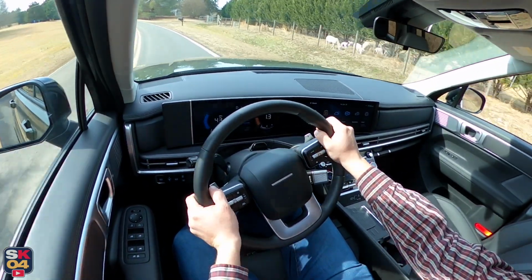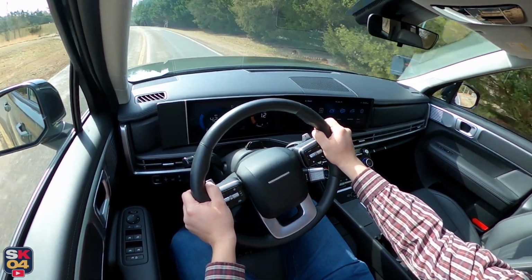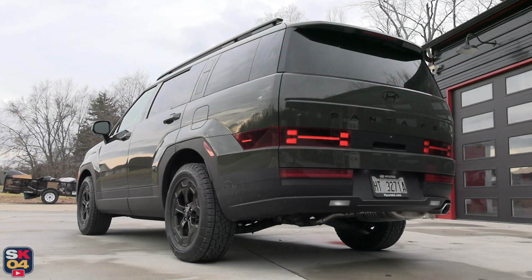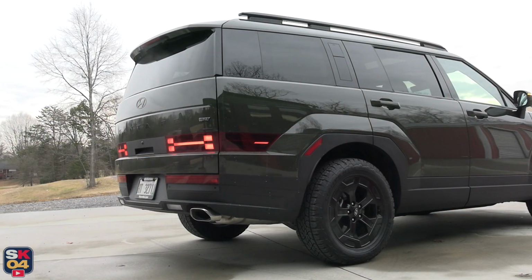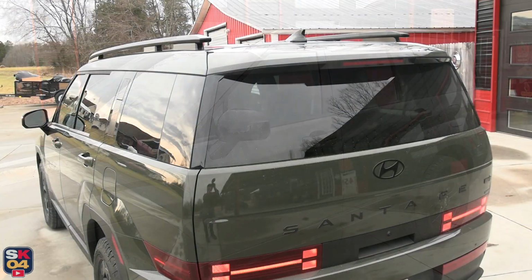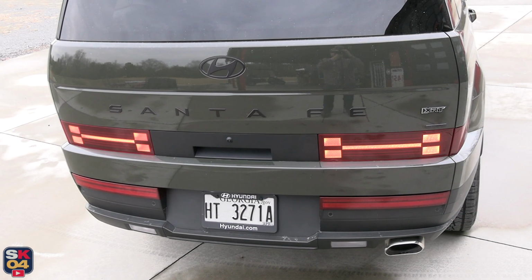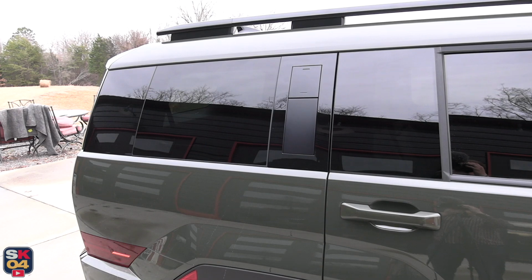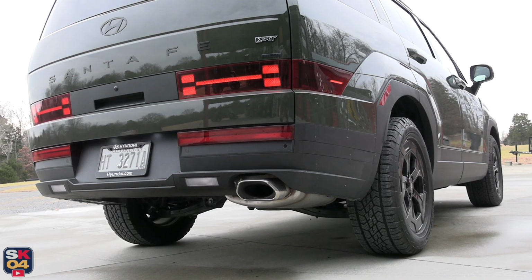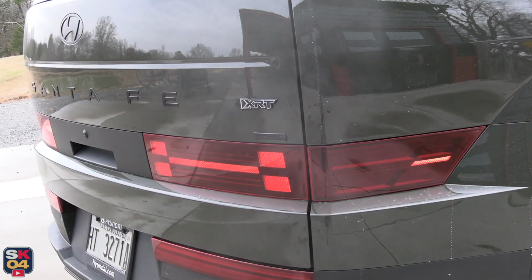The new 2-inch longer wheelbase gives the side profile a more stately look that reminds me of a Land Rover Defender. Overall length grows by 1.7 inches. Clean side sculpting is complemented by a flatter roofline, robust wheel arches, shorter front overhang, and available 21-inch alloy wheels. The front overhang has been shortened by 1.18 inches. The cowl sits 2 inches further rearward, the rear overhang is increased by 1 inch, and the ride height is 1.4 inches higher. From the rear, the wider liftgate opening conveys stability while leveraging simpler sculptural surfacing details.